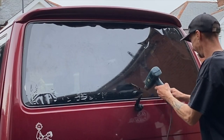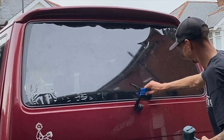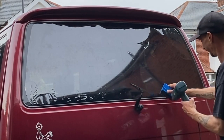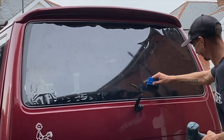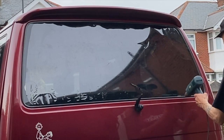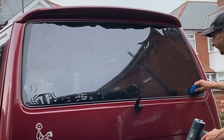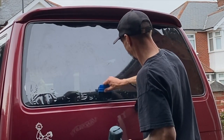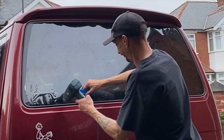And also, another little tip for you is take that wiper off. That wiper gave me so much grief because I didn't take it off, just to save myself 5 minutes. You don't even have to take it off, you can just slacken the nut on there, release the wiper, swing it around a little bit and then push it back against the body of the car.